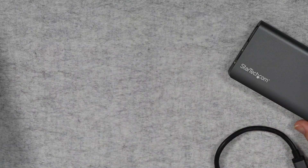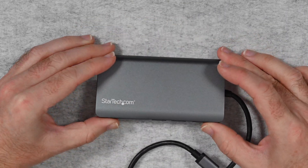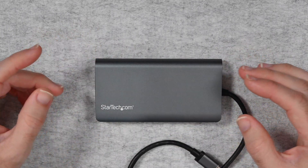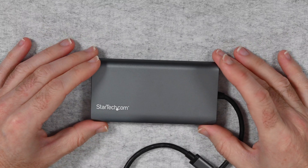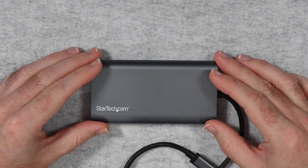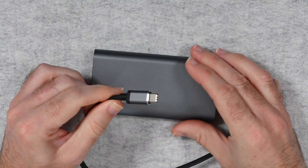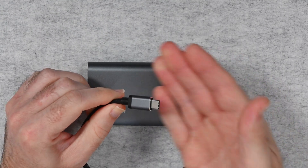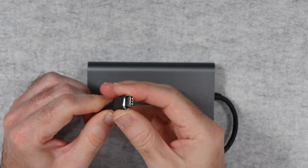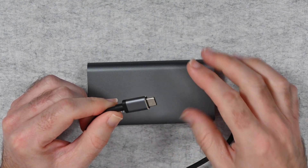Let's take a look at the product itself. It's a really cool product, very well made. I've been so pleased with how this has been performing because it is a multi-port adapter and it just proves its worth because of the variety of ports on here. It has got a captive cable terminated with a USB-C connector. You can plug this into a Thunderbolt port as well because Thunderbolt is backwards compatible with USB-C — but this is USB-C, not Thunderbolt 3, so do bear that in mind.